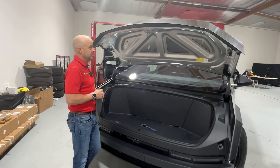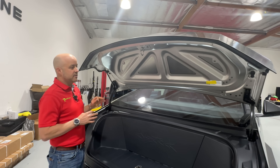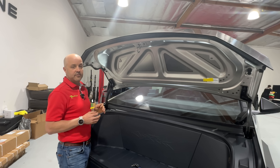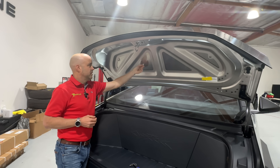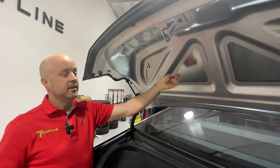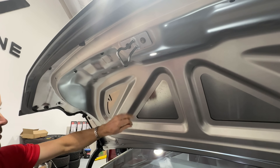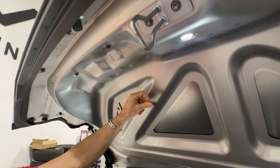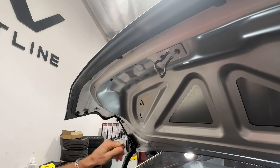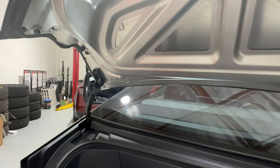In the previous video I talked about the stainless steel being partially magnetic. We've done a little more digging and confirmed this — the stainless here is a proprietary stainless alloy from Tesla. It's partially martensitic as a result of the cold working it goes through, so it's basically a stainless steel with some partial magnetism. It's stainless so it's not going to rust, and it has partial magnetism. This substructure to the front panel is also stainless steel but not magnetic at all. There are components made from mild steel that are highly magnetic — your bracketry, hinges and such.